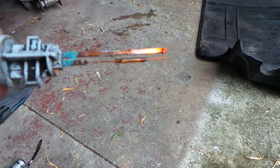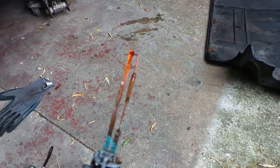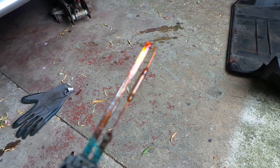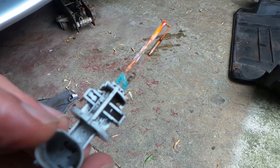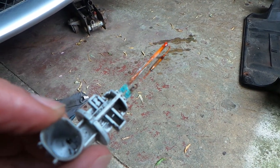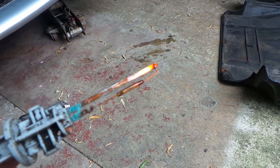The contacts of that reed switch will either close or open in the presence of a magnetic field. These sensors work by a magnet inside the expansion tank which, when in the vicinity of that reed switch, either opens or closes the contacts. The fact that the light remains on when the connector is disconnected tells me that when there's good fluid level, it must close those contacts — and closed contacts corresponds to the light being off. Let's investigate that theory by shorting the contacts in the connector.